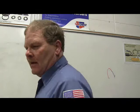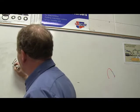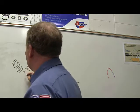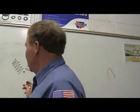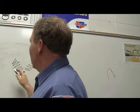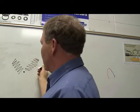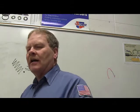All right. Now then, on this particular thing here, imagine yourself with a couple of copper windings. And the gauge needle is actually going to line up with the one of those that's got the most magnetism, right? And so if you can set it up so that you're powering and grounding this coil, and there's no ground coming through the sensor, the gauge is going to read a certain way, and then when there's a full ground coming through the sensor, as it goes up, you're going to read the other way.